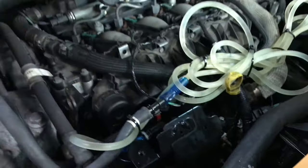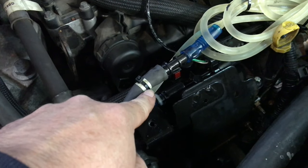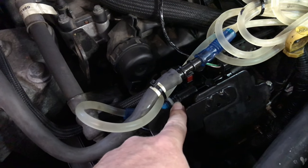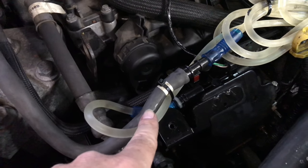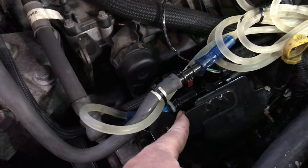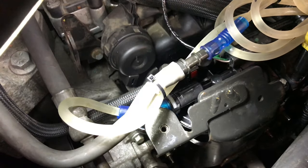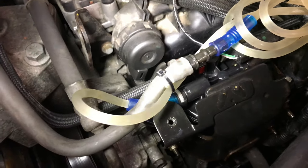So we went under the engine bay. There's the fuel filter there, so we decided to pull the fuel intake from the pump up to this filter to see if there was fuel coming out — and indeed there wasn't any fuel. We then decided to use a little electric pump and put it right into that position, and the car started eventually. But the filter had been changed.